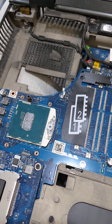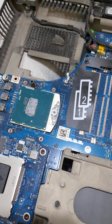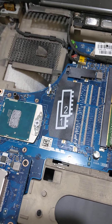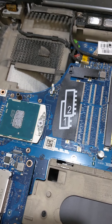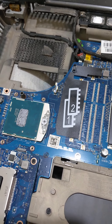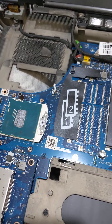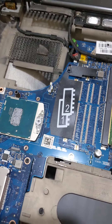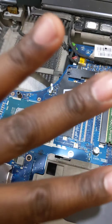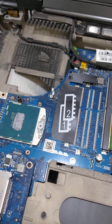This chip is actually worth about $70 on eBay, which is amazing for a chip that's almost six years old. I definitely want to resell it so somebody can give it a second life. I went on eBay and purchased an i7 4810MQ chip — that's a four-core chip running at 2.8 gigahertz, which is 0.1 gigahertz less than this chip at 2.9, but that's okay because this chip only gives me two cores.